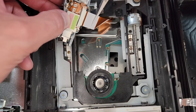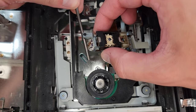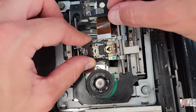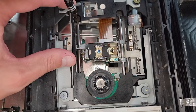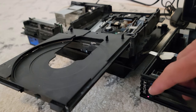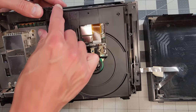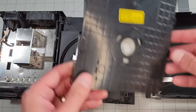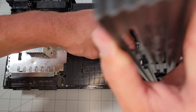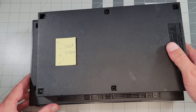Now we'll reassemble and see if those laser adjustments did the trick. After reinserting the flex cable and closing the latch, we can lower it down and set the first rail in position. The second rail goes back through the bearings and sets in the catch of the plastic liner, just like the first one. We'll fasten each screw for the rails, test the motion, and clean the lens with rubbing alcohol for good measure. Time to close that disc tray — we'll plug in the system and have it do that job for us. Since I partially removed the drive earlier, I'm just going to snap it back into place and fasten the cover back down. As I begin to close the shell, I stick the tape on that flex cable back on the cover of the optical drive and lean it towards the face buttons to help avoid any snags. Now we can flip it and get the screws and caps back in place.